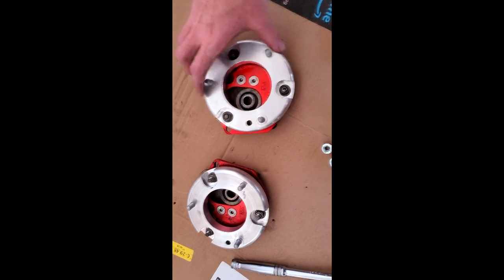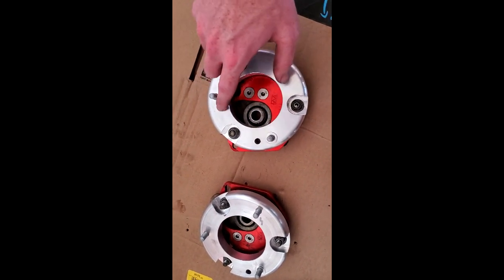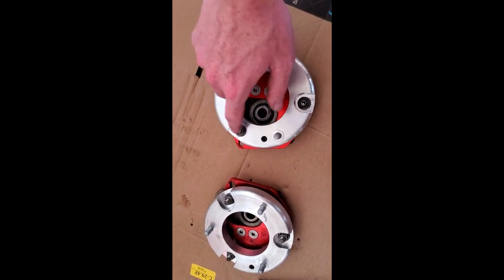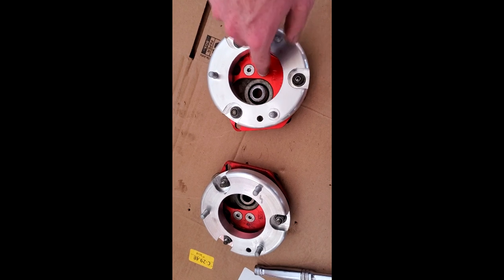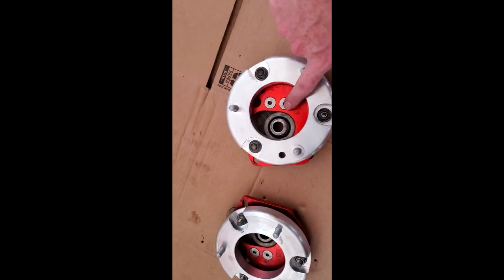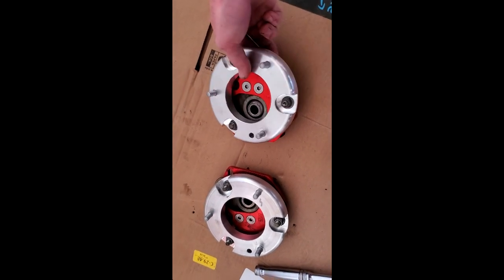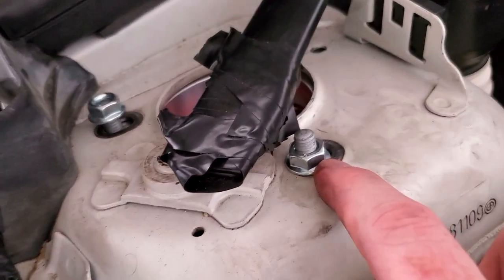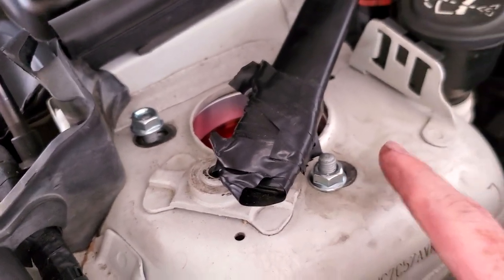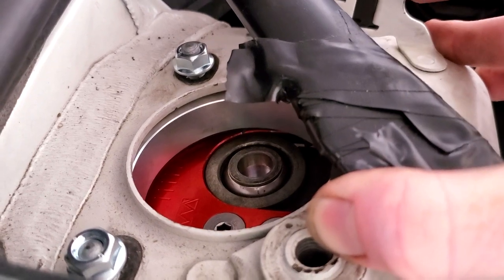This solution does have a notable downside for those with camber plates: you've lost the ability to adjust camber on the fly because the camber plate bolts into the spacer first, so the only way to reach those bolts and adjust camber is to drop the strut, which is a pain. In my case — and I'm guessing for a lot of BMW owners who drive aggressively — you're just maxing these things out anyway, so I've set them to full negative for the tire clearance I need from the fenders under full compression. There is a slight amount of adjustment in the actual bolts in the strut tower, good for about 0.3 to 0.4 degrees of camber. When setting up initially, put them in the positive position with bolts facing out toward the fender so you can still reach the strut top nut to get it tight before torquing everything to final spec.